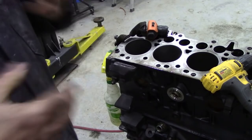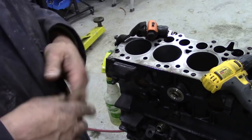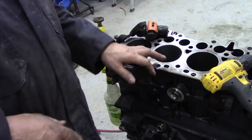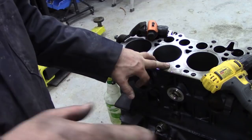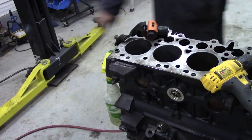Washing off in diesel just makes a waxy, oily film that doesn't always come off, so use whatever methods you can. Before I steam clean it, I'm going to use a proper engine degreaser - spray that on and then we'll come back to it. Then it should be about ready for paint.